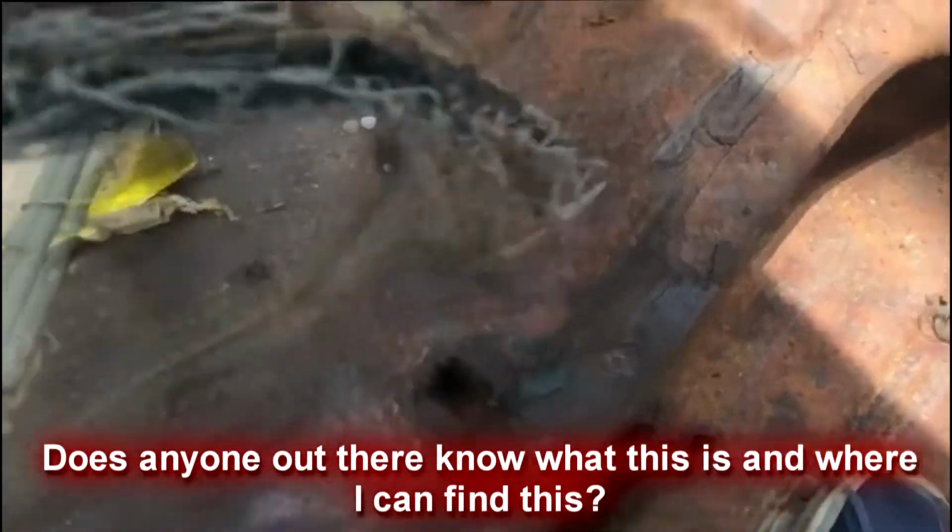Okay, so just note that along this channel here at the bottom, there looks to be seam sealer. So you've got this little seam sealer here, and then you've got this little additional piece of the windlace that is like a molding. It's got rubber in it, but as you can see, it's cloth, but there's like a rubber filling in there. Okay, so I've got the windlace off. Now it looks like it was tacked right over here, a tack tacking that in when the windlace goes in the headliner.